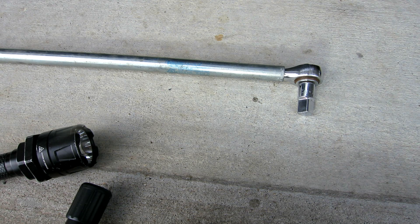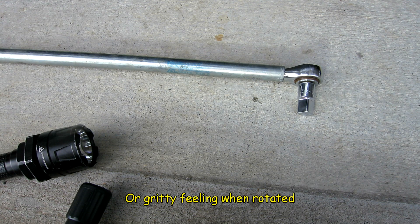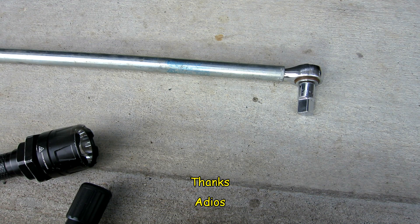If you want to check your belt, that's a good way to do it. Go from the bottom to take the tension off the tensioner, then go from the top with your hand to actually feel it and see what it feels like — that's going to tell you. Feel is everything on this. There's no way to measure anything. You put your hand on it and you feel it, you pull on it, look for any kind of looseness in that bearing. Any looseness at all and it's bad. Any kind of noise and it's bad. But this one looks good. I feel a little better about it because I'm fixing to take a 500-mile trip and I'd hate to have to deal with that on the road. I hope this helps. Until next time. Adios.